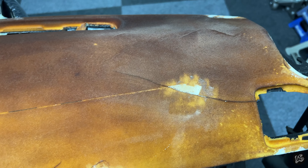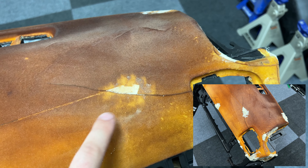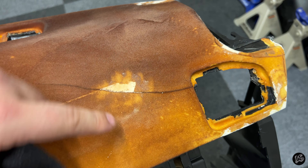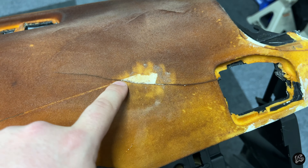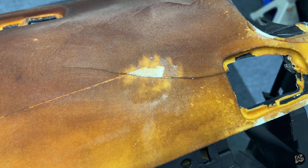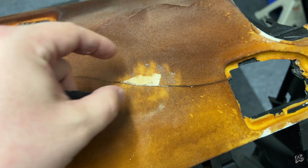There were a couple areas that chunked and I was able to fill this with expanding foam from Home Depot and let it set up for 24 hours. Came back out, I took the blade off my little hacksaw and I just shimmied through the large chunk of it. Then I took 80 grit sandpaper and smoothed it off. I liked it a lot because the expanding foam is a lot harder than the surrounding foam, so the sandpaper sands it off a lot better than the surrounding.